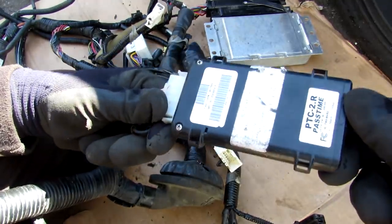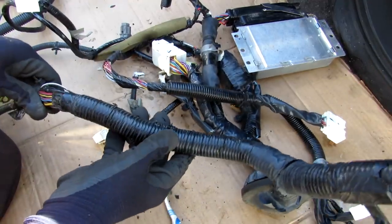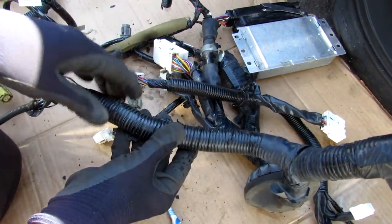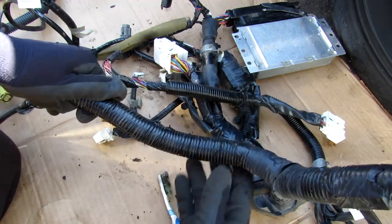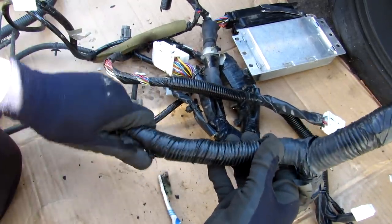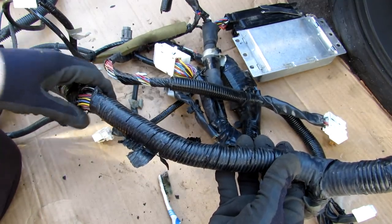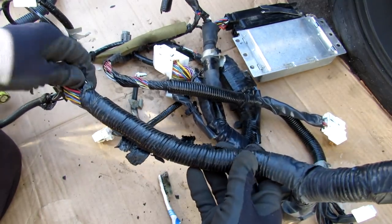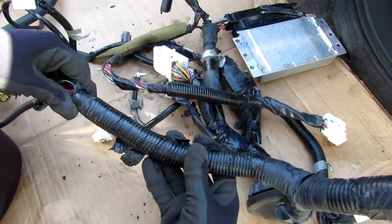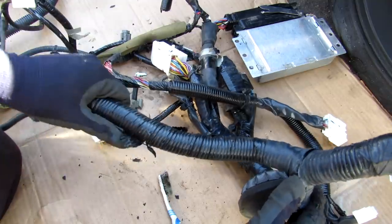This is actually one of those GPS vehicle trackers installed on a lease vehicle. One of the weak points of your electrical system is definitely the harness itself — the section that routes through the engine bay can become very brittle because of heat cycling from the engine, making it easy for wires to just break off. It's difficult to diagnose because this piece is probably under the hood, under the cowl, or inside a fender hidden somewhere.